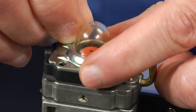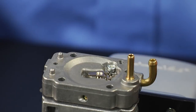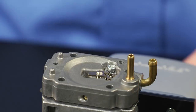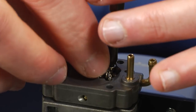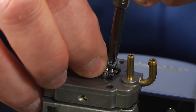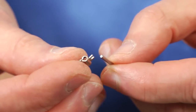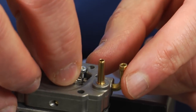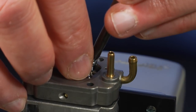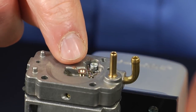Let's take the old assembly out of the carburetor and install a new spiral diaphragm. First, remove the metering cover, the old diaphragm and gasket, and we have to replace the metering lever. And as always, this is a little bit of a tricky process. Remove the pin from the old lever, install the new metering lever — as you can see there's a little spoon shape on the new metering lever.